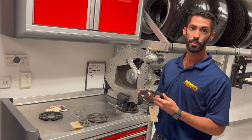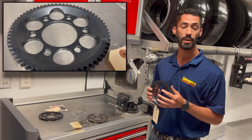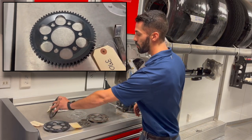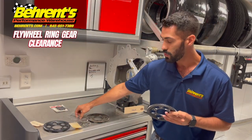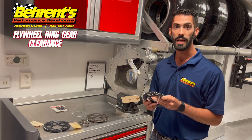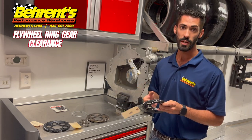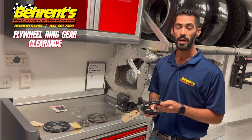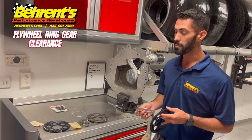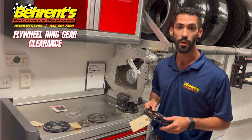Now, Behrent's made this super easy because they've developed a ring gear that's got 80 thousandths clearance already built into it. Back in the day, they were using a standard ring gear, and you would have to use shims, and a lot of it turned into guess and check with your feeler gauge as to how many shims to add, removing bolts, adding shims, or taking away shims, and the clearance just became a very harder thing to achieve. And like I said, Behrent's made it super easy because that clearance is already built into the flywheel.